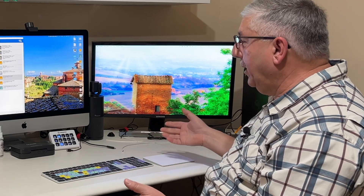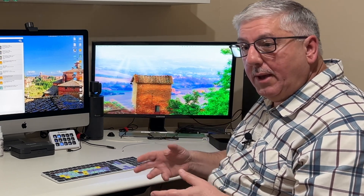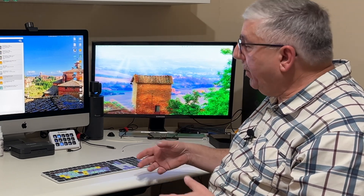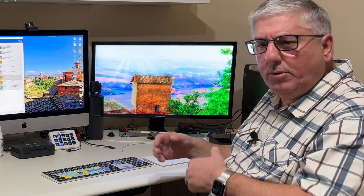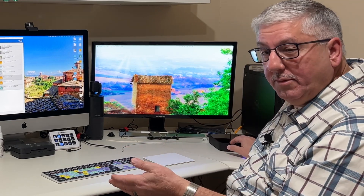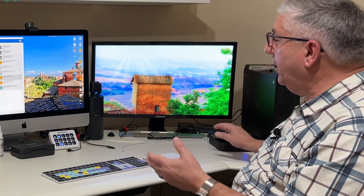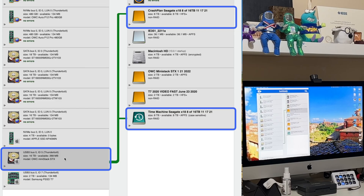The really cool thing is that I want to be able to back up the Mac. We use CrashPlan to back up the Mac remotely, but you can also use CrashPlan locally to your own disk drive, so if you do have to restore, it's faster than waiting for data to come over the internet. We also have Apple's Time Machine. So what we did is put a 16-terabyte drive into the STX and partitioned it into two volumes — one volume for CrashPlan, giving it 8 terabytes, and the other volume for Time Machine.